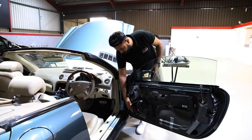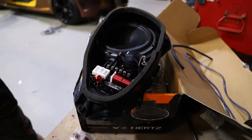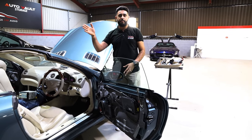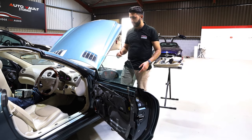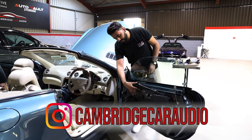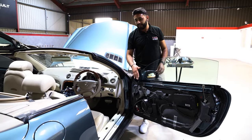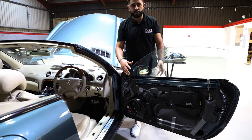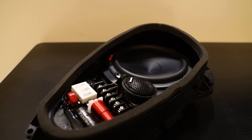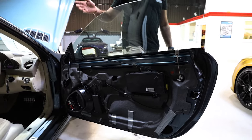We've run fresh cable into these doors as well, using connections-grade wiring. The reason the bonnet's up is because we're running cable from the amplifier behind the passenger seat all the way to the battery at the front. Behind the scenes everything is acoustically soundproofed — all the foam inserts from factory have gone back in — plus we've got custom baffles built to allow for the speaker configuration to work really nicely in here.